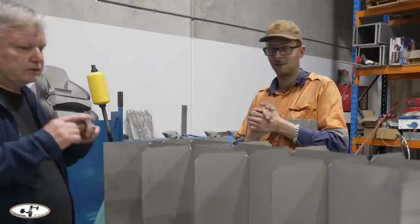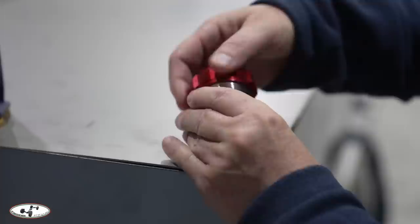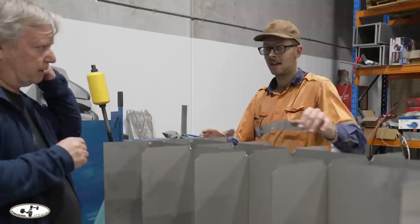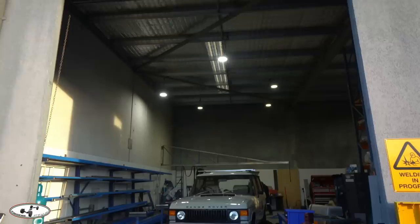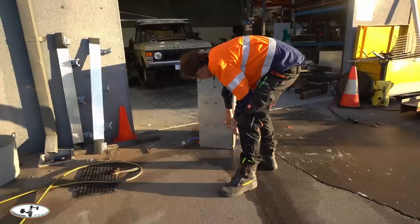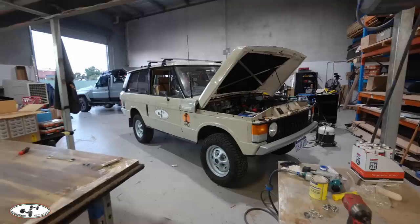The only edge is welded along the bottom and top, reducing the welding needed — in effect it's spot welded everywhere. We have an auxiliary external fuel pump mounted to it, not a submerged pump, so if there are any dramas we can always siphon the fuel out another way. No electrics touching where the fuel is means reduced fire risk. Pressure testing the tank is of course very important: air is pumped in and then it's checked for leaks by spraying it with soapy water.